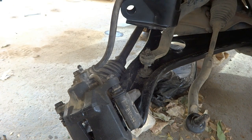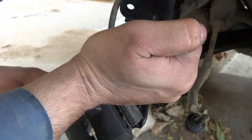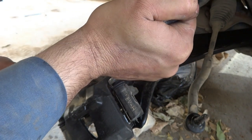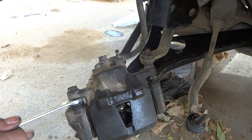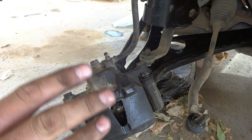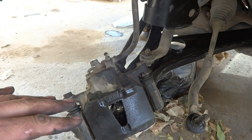And now is the time to tighten them using my 14 millimeter and 14 millimeter open. I have to fix it over here and then tighten them thoroughly. Here also the same practice I have to do. I have to tighten this bolt. Like this, and then I will put new fluid and will bleed it over here, but this will be while the brake will go in, and each and everything will be fixed, and afterwards I will bleed the brake and will finish the job.